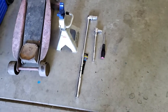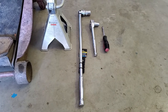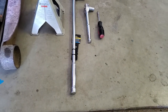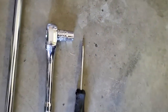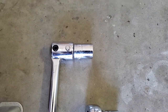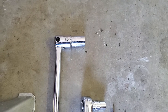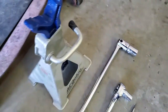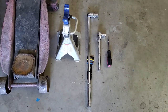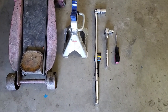I'm going to do things the Fix-It Dad way, which is the easy way. I don't have a lot of specialty tools. All I'm going to need is a 14mm socket, a flathead screwdriver, and a 21mm — I have it on a breaker bar, you can use a star wrench or whatever — just to break the lug nuts loose. You will need a jack stand for safety and a jack, obviously. Those are the only real tools you need to support the vehicle properly. So let's go ahead and walk through what we need to do and how we need to do it.